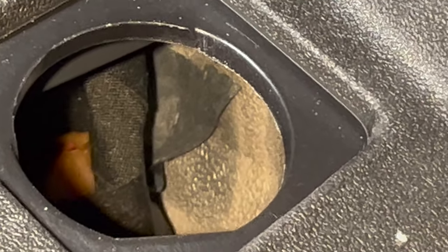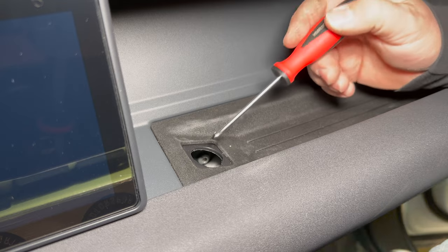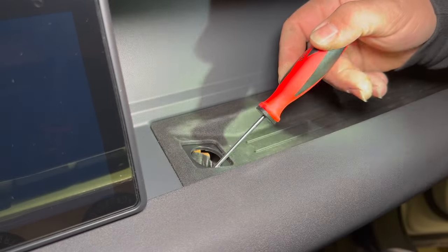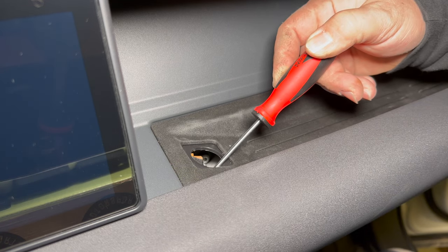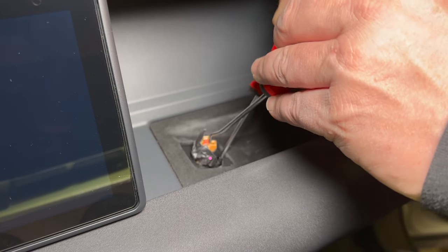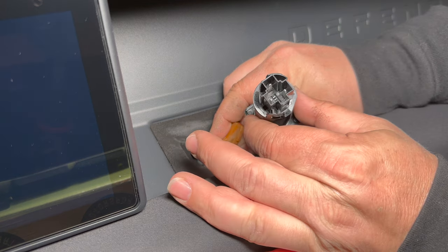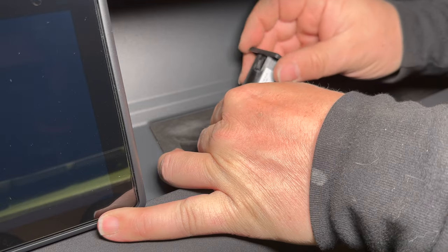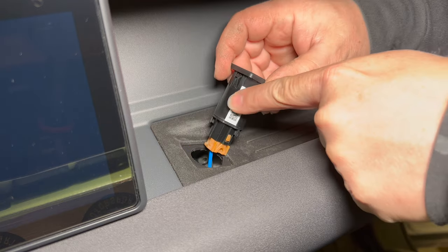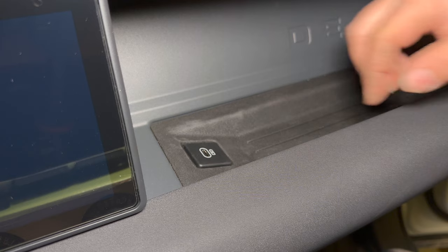There's the end of the tape. I almost have it wrapped back around the wire that it's taped to, but I just can't get it with my fingers alone. Let's try a couple of little hooks. Okay, I got the connector. I just need to figure out how to maneuver it out of there. There we go. Get this tape off of here. With the connector held up here, now I can connect it into the back of the USB port and then slide the whole thing in. There is a flat side — the rest of it is round, so this will only go in one direction. There we go, and that's done.